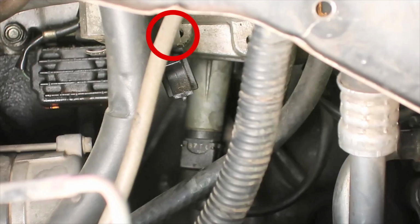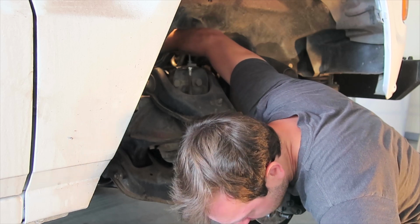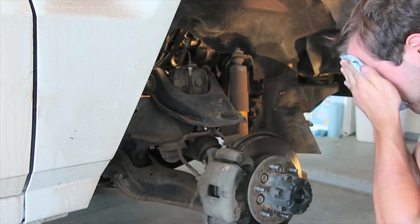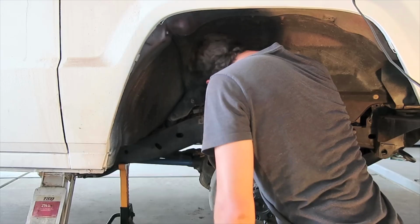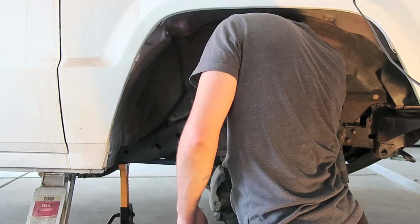You see, there are 2 bolts which are facing the engine and nestled underneath the intake manifold. This makes it very difficult to get any tools back there, and when you do, and you finally get it around the bolt head, you can only really turn the bolt a few degrees at a time, which makes it an excruciating experience.